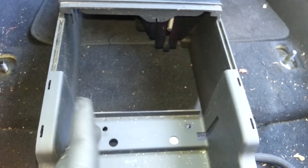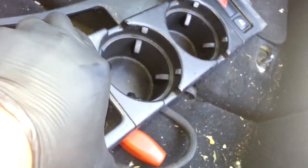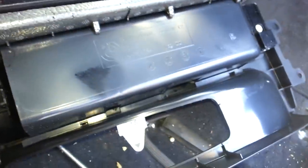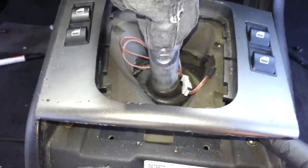This is a good technique to know because if you need to replace this cover here, that's how you remove it. Same thing if your rear cover gets broken and you need to replace it, now you know how to do it. The coin holder and cup holders are pretty easy to remove — just slide up firmly and you can put a replacement. The only two screws holding the center console down sit right there, and of course up front right there under the shifter cover.